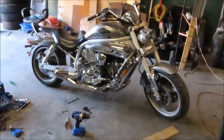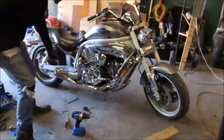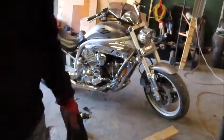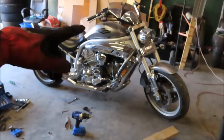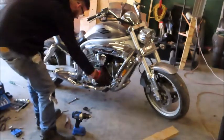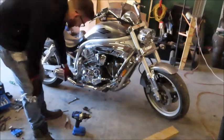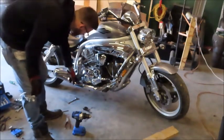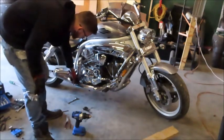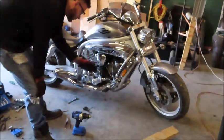I'll definitely have to move the rear shocks — there's one on each side. I'm going to probably clearance the subframe somewhere around this area and then build mounts for that. Whenever I put the shorter bars on it, my seating position is going to be very uncomfortable because of the foot pegs, so the foot pegs and the rear brake assembly are going to have to be moved back. On one side it'll be pretty easy, but on the other side we're going to need some DOM tubing, come off the frame right here through the exhaust, and the mount will have to hang off of it, then I'll fill in that area.